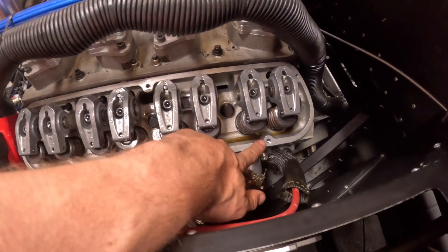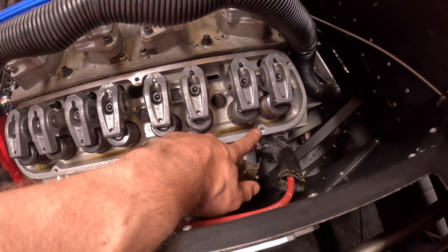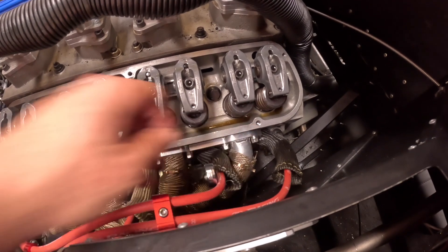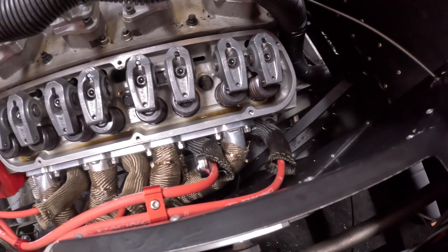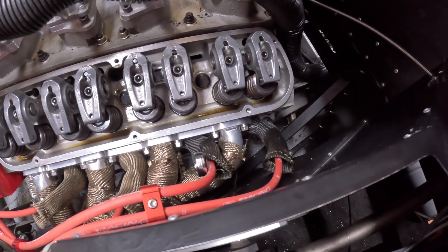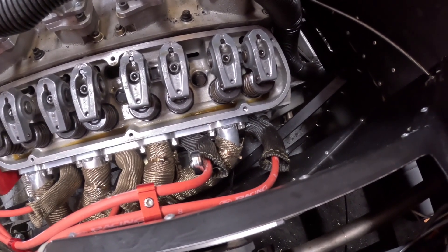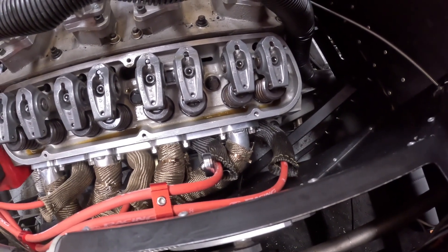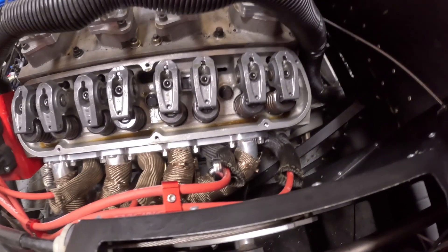I want to point out something I haven't encountered before when doing a helicoil. After I did this helicoil and went to put the valve cover back on, the bolt really did not want to go in. There must have been some debris or I hadn't gotten the thing fully tapped far enough, so I had to run a quarter-twenty tap through there after putting the helicoil in — and now it works just fine. Don't get frustrated and try to force it; that'll just make it worse. Just take your time.